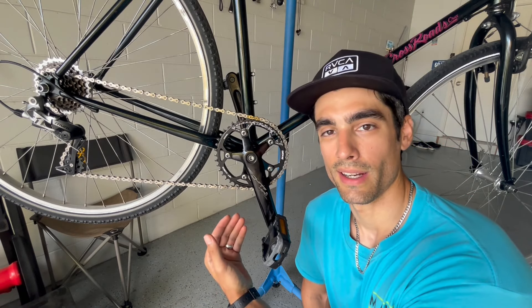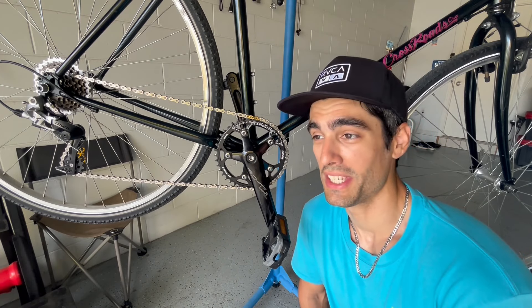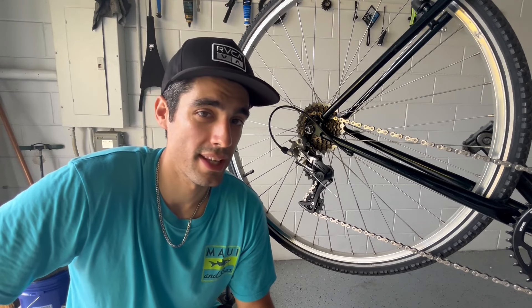I put the chainring on the inside of the crankset. I reused my FSA Varo crankset that you may have seen in the past — it had alignment issues — but since it's a 1x it doesn't need to shift, so I don't have to deal with any front derailleur rub.